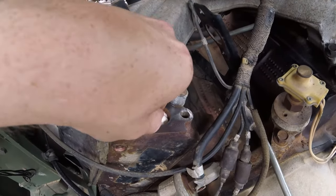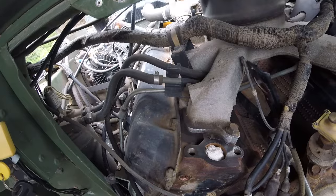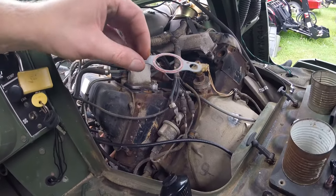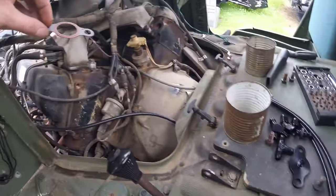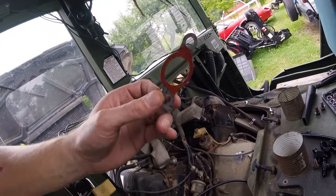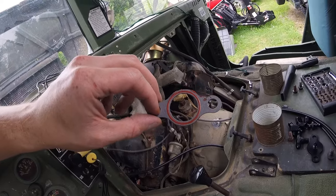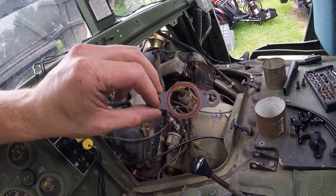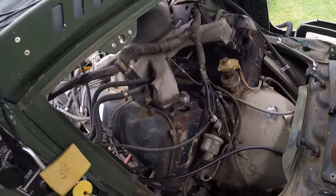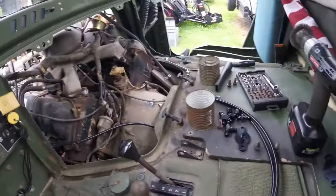Pull the paper towels out and use the shop vac to catch any debris that may have fallen in the holes. Now we can mount the fittings. Note: the red ring faces up and butts up against the plate with the breather hole on it. I'm putting a little high-temp RTV on the bottom side of the gasket — the kit doesn't specify this, but experience has shown it really helps prevent leaks. Just a little bit around the hole on the cooling head.